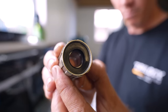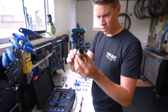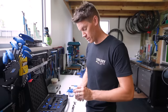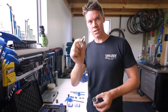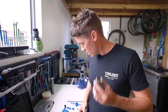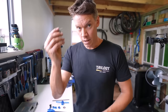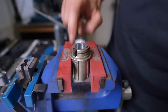Aaron tests something here: the Kogel bearings have good road seals, but cheaper hubs often have a big fat rubber seal he doesn't like because it restricts rotation. Since the Kogel bearings already have their own seals, and the free hub body also has end seals, Aaron decides to remove that extra rubber seal to eliminate the rotational restriction — noting that you should avoid jet washing and take care of the bike.